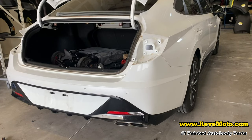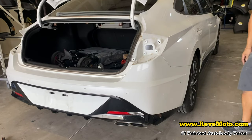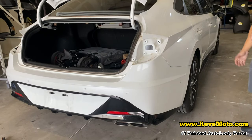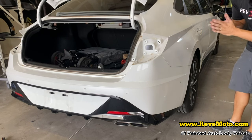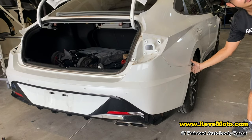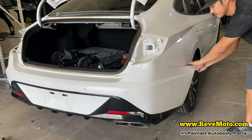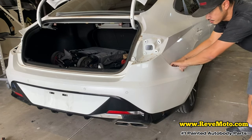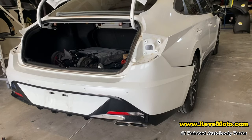At this time I believe that's all we've got to take off, bolts-wise and pushpin-wise. I'm going to go to one side. Remember, you guys have these sensors right here, so you don't want to pull too hard — if you pull too hard, you might actually yank the wire off, and that's going to cause you more problems. So just go ahead and gently pull right here. You're going to hear a click — a little bit of force, but not too much. Leave that dangling; I'm going to go to the other side and do the same exact thing.